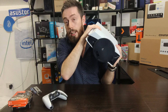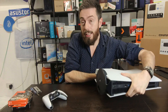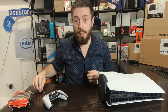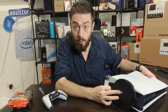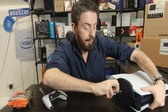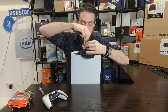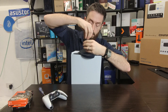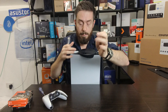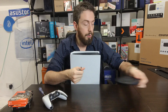So you've got the system here in stand-up mode, and as you can see on the base we have got that screw right there. You're going to need a flat head screwdriver to do this, and you will need a cross head screwdriver later on in the video. What we're going to do is remove that screw from the base — remember, lefty loosey righty tighty. Remove that screw — it's very straightforward, and once you've done it you can do the rest by hand. Remember there is a small bay inside this system where you can pop that screw so you don't lose it.